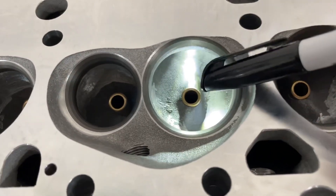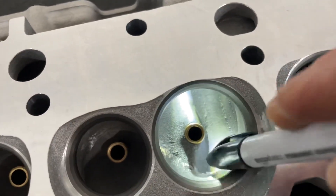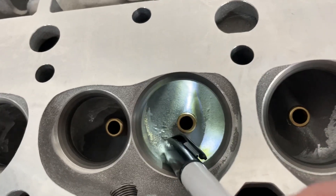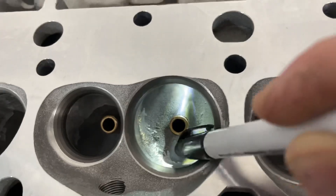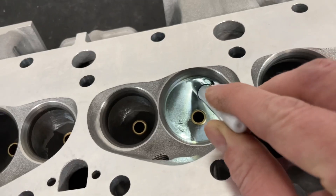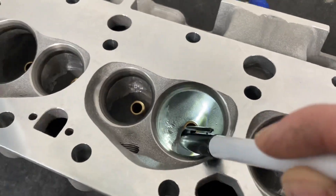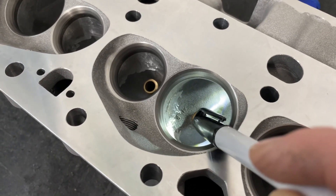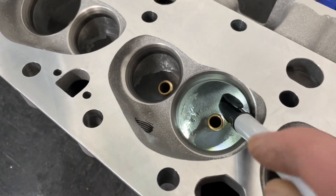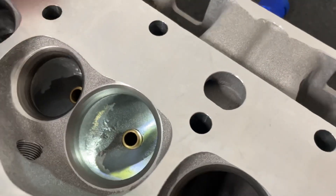Focus right here - notice how deep it is on this side of the bowl. On that side it's like a normal head would be, going all the way towards the bottom of the guide. What Profiler did on this head is they filled up this side, so this side is normal depth but this one is raised all the way to the top where this vein is. Usually it's sunk in, so there's definitely a difference there - it goes all the way back to where the rocker stud hole is. That does kind of remind me of the old swirl-port small block Chevy heads from the 87 trucks - they had those big ports that came up through here and were filled in. That's the major difference between this one and the 195.